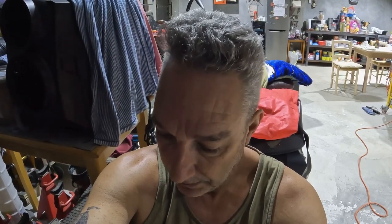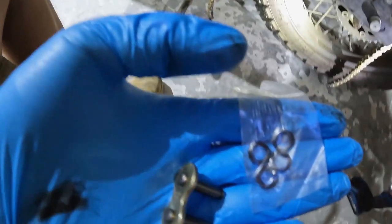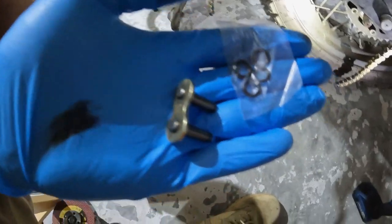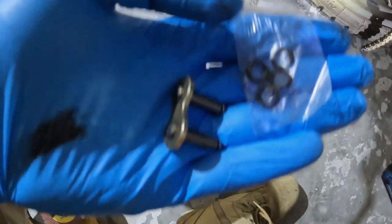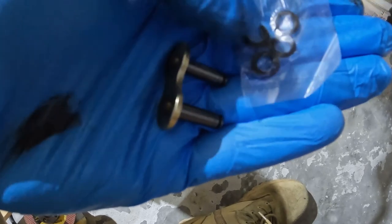What I've been doing is cutting the chain in two and then cutting part of the link off. I'll attach the new chain to the link and just feed it through so I don't have to take off the sprocket cover. There are two sets of links — the press-on rivet type and the clip-on — and both come with grease and four O-rings.